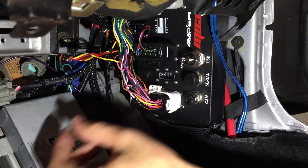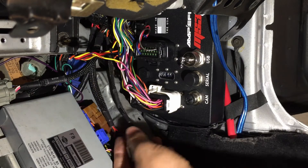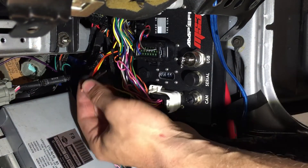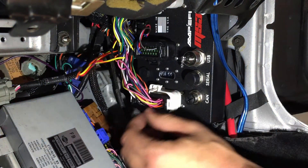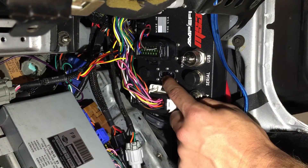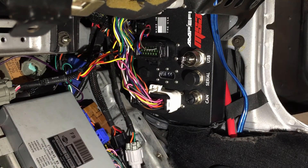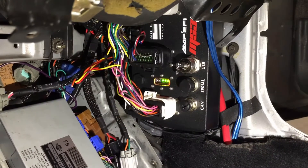After some troubleshooting, I had a wiring issue with the ECCS relay that came with the previous harness — this was ordered through Wiring Specialties back when I first built this car. I figured that out and actually got this to power on. I have a few wires I haven't connected yet because those are either not in use due to the switch over or to be used later on. But I will power on the ECU. You should see four green lights and your red light — the red light is just a digital I/O, you can ignore that for now because we haven't configured any settings yet. You heard the priming pulse from the injectors, so nothing to worry about there. We are all good to connect and get some configuration started.